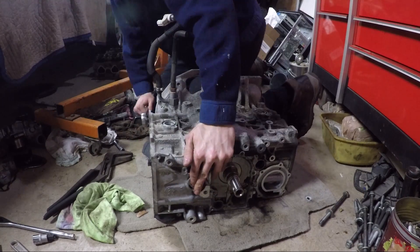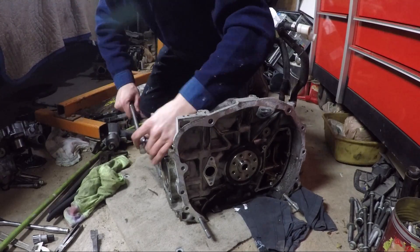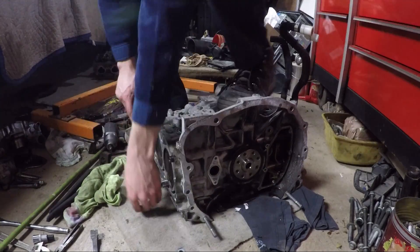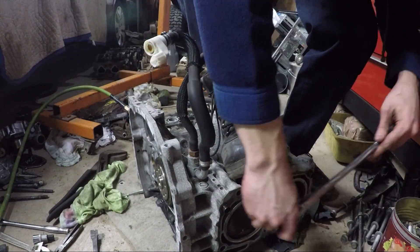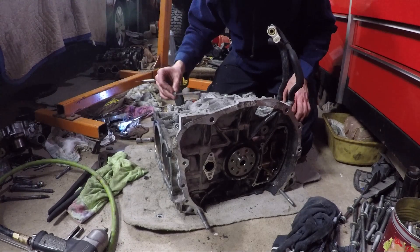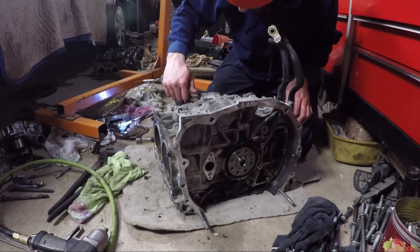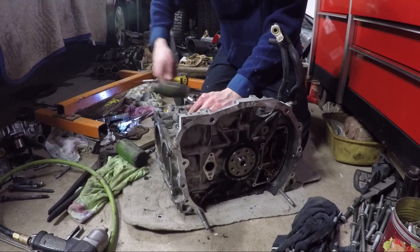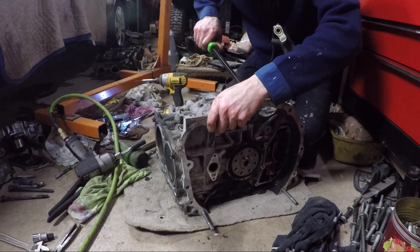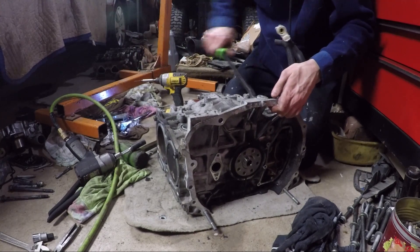Once the rods are no longer connected to the pistons it's time to remove the bolts that hold the block halves together. There are seven bolts on one side and 11 bolts on the other side. Just a heads up — they're on there even tighter than the cylinder head bolts. Even after you remove all the bolts the halves still won't split. I had to use a rubber mallet, one of the bolts, and a pry bar to split the engine. I threaded the bolt in as far as it could go and hit it to start splitting the block. On the other side at the transmission cover I used a pry bar to help split it. If you use a pry bar you have to be careful not to use it somewhere that can cause oil or coolant leaks later.